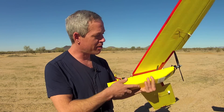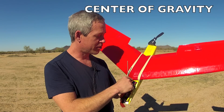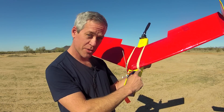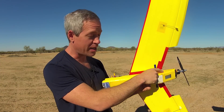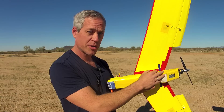The first matter is the center of gravity. In the build videos I've discussed locating the center of gravity eight inches aft of the very nose of the wing, which is essentially the same as these wing tie-downs for your visual reference. I've marked this blue stripe at eight inches aft. This is the do not exceed center of gravity rear limit unless you're an excellent pilot and an expert builder.